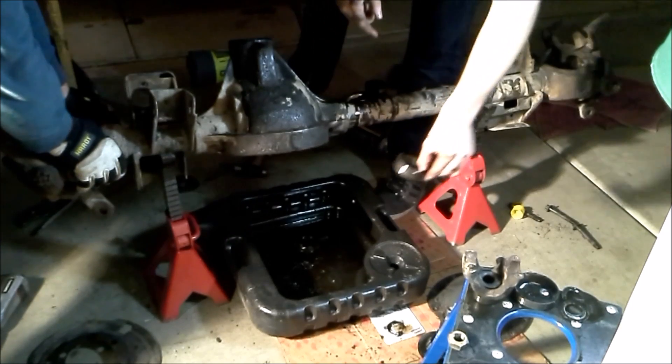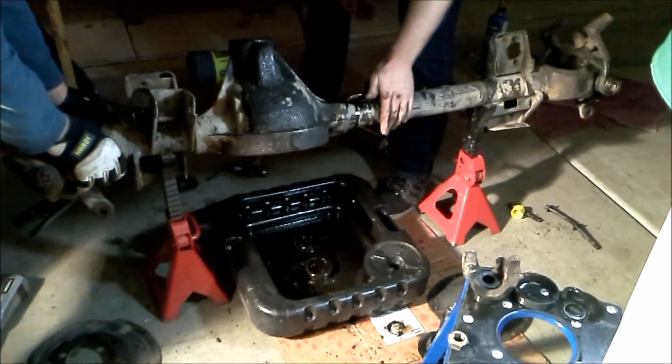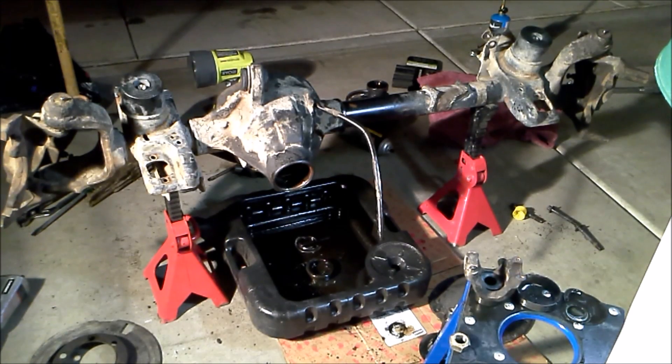There's the race, and that was a shim there. I did end up having to use a metal punch to remove the races. If you're replacing your bearings, it's a great idea to replace your races as well. The races and the bearings kind of end up wearing together, so replacing one without the other just isn't a good idea. The only reason to remove your race is to replace them anyway, so if you damage your races while removing them, that's okay. Just make sure you don't damage the metal of the axle itself around the races.